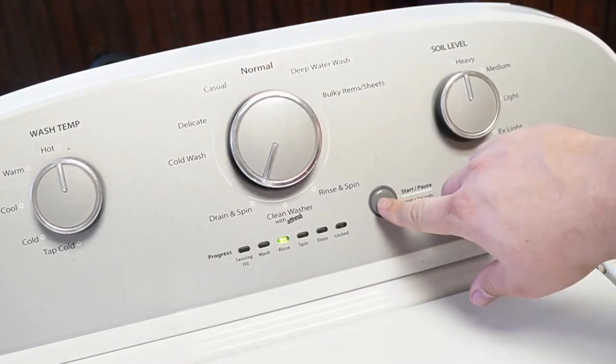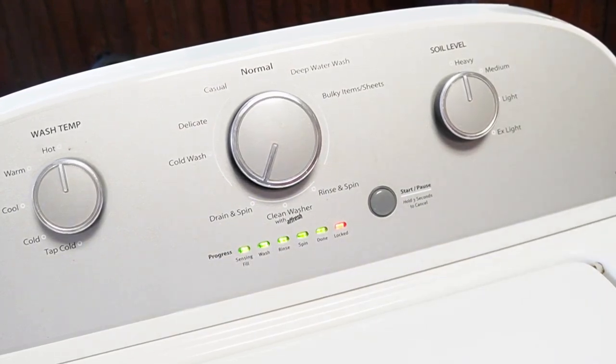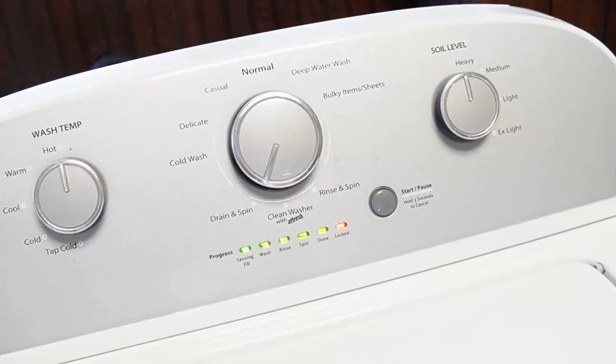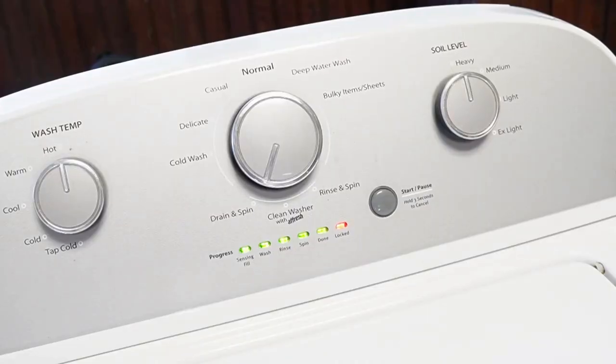Once you press the start button on the rinse mode, the door lid will lock and it will begin a series of tests and operations on your washing machine. All these tests take approximately three minutes to run all the way through. As the recalibration mode runs, every part and process on this washing machine is going to be run, and the machine will physically reset all the components to a default state, allowing them to run at an optimal level. This is a must-have when parts aren't working right, or the machine just doesn't know what state it's in — like if you've replaced the shift actuator or even a control board. During this time you're going to hear all kinds of noises from the machine, and that's totally normal. When the calibration mode ends, every single light is going to turn off, including the lid lock light, and the machine is now ready and recalibrated for use at an optimal level.